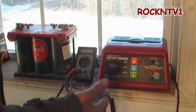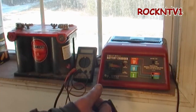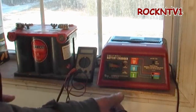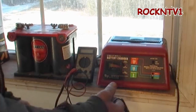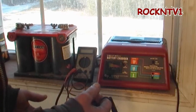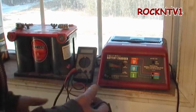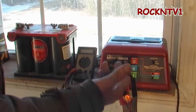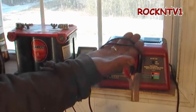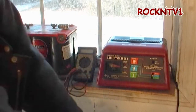So that being said, there was a guy on YouTube trying to start a completely dead battery — and no battery charger is going to help a completely dead, junk battery. The battery's sulfating inside, it's low on electrolyte, and you're just not going to bring it back. This brings me to why, if you'd ever been in a garage that actually had a charger, the thing had wheels and weighed like 100 pounds — because it's got a giant transformer and cables that are probably 0 or 2 gauge. Because a starter on your old Chevy pickup truck might draw 150 amps, and there's no way you can get 150 amps — or even 50 amps — through these cables without them melting and potentially starting a fire.